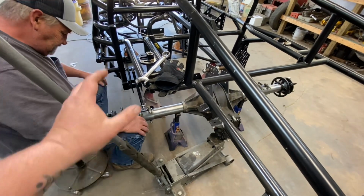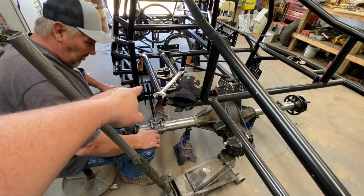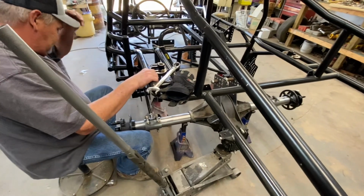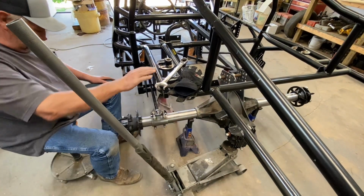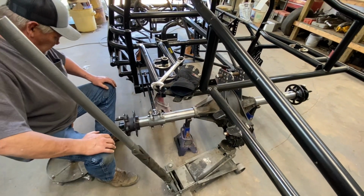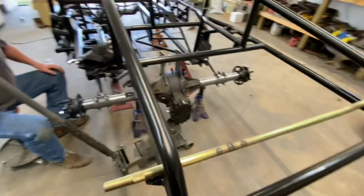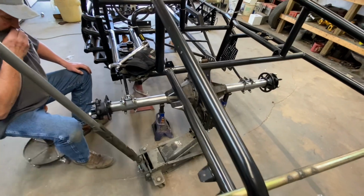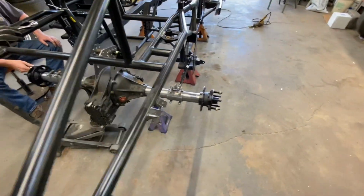And the best tubing that we have found to make those spacers to fit a half-inch bolt is steering shaft. The three-quarter steering shaft, it is half-inch inside because it's thick wall. It works great for those bushings, and we'll get some misalignment bushings for the bird cage because we actually built those with misalignment bushings in them. So, yep. Pop's kind of got it stuck together.